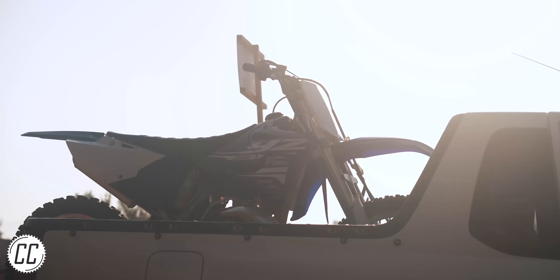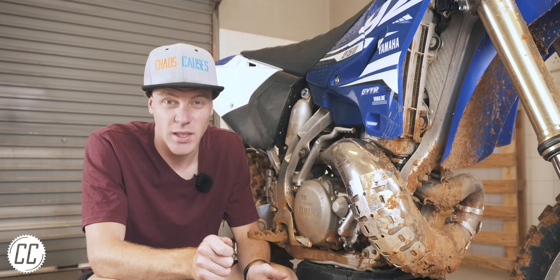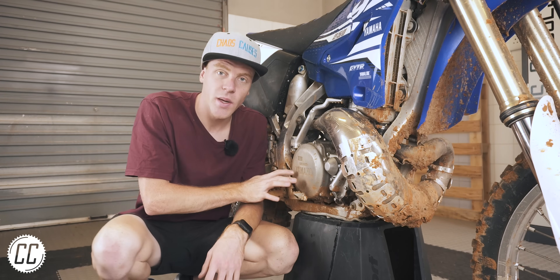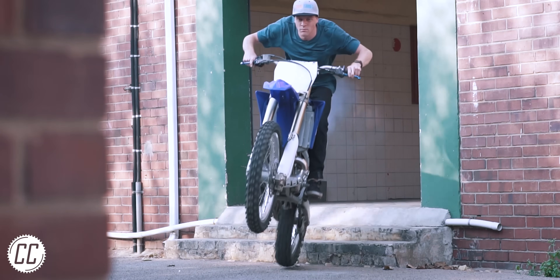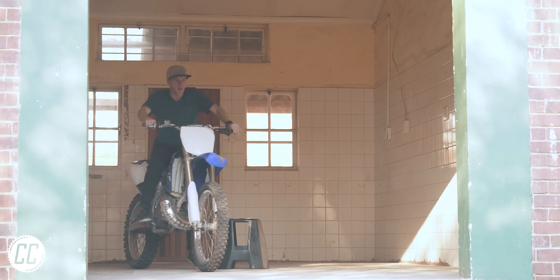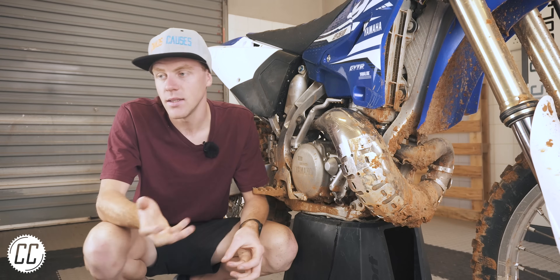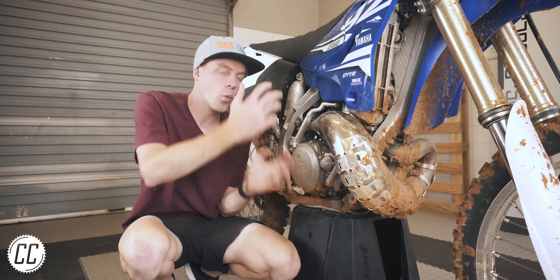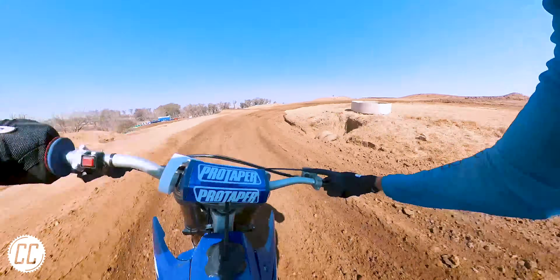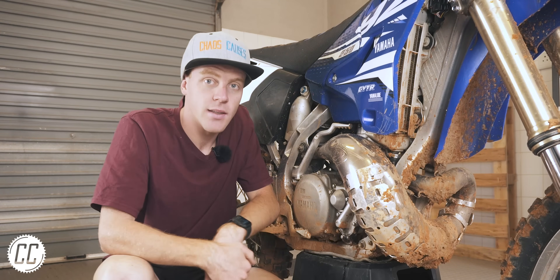I usually think I'm pretty good at warming up engines before riding them hard — I hate seeing someone at the track start their bike and rev it to the limiter a few seconds later. But there was one incident I now regret. The night we got the keys to this workshop, I brought the dirt bike here and decided to ride in and out to celebrate. Because other people were working and I didn't want to annoy them, I didn't warm up the bike — I just started it and rode. In hindsight that was stupid because the bike was still cold and it did rev fairly high. With a two-stroke the oil is in the fuel, but you still need to warm up the transmission oil and let the metals reach operating temperature before revving higher. I'm never going to make that mistake again.